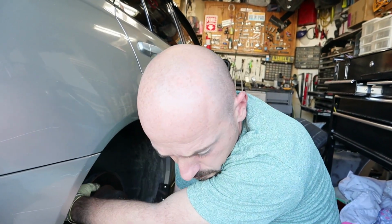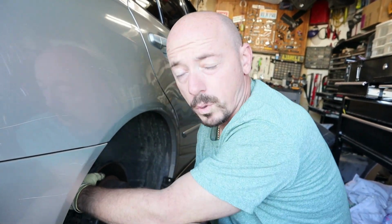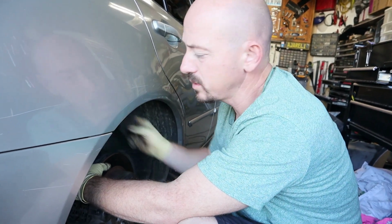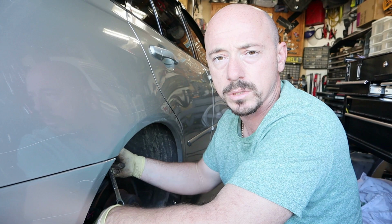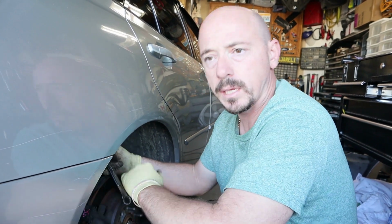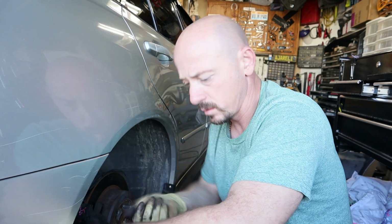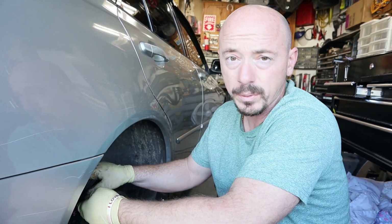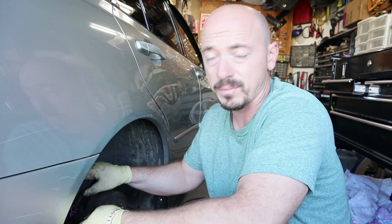So, no power tools, hand tighten it. If you put in a bolt and you feel that it's not going, don't just take power tools and hammer it or whatever. Take it out. It's probably getting sideways. So take it out, hand tighten it, and then use power tools. Well, not on the brakes, but if it's something that you have to use power tools on, use the power tools at the end.